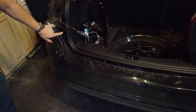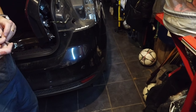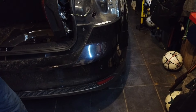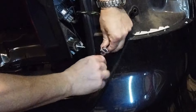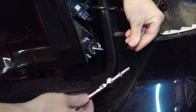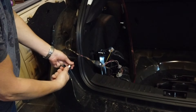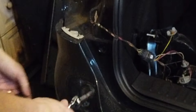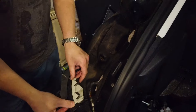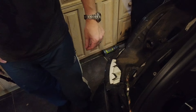We've got two clips at the back and two 7mm bolts there with big self-tapping threads. This is what's holding the bumper in - we've got to push down those tabs and release it, but we'll undo the two side bolts first.